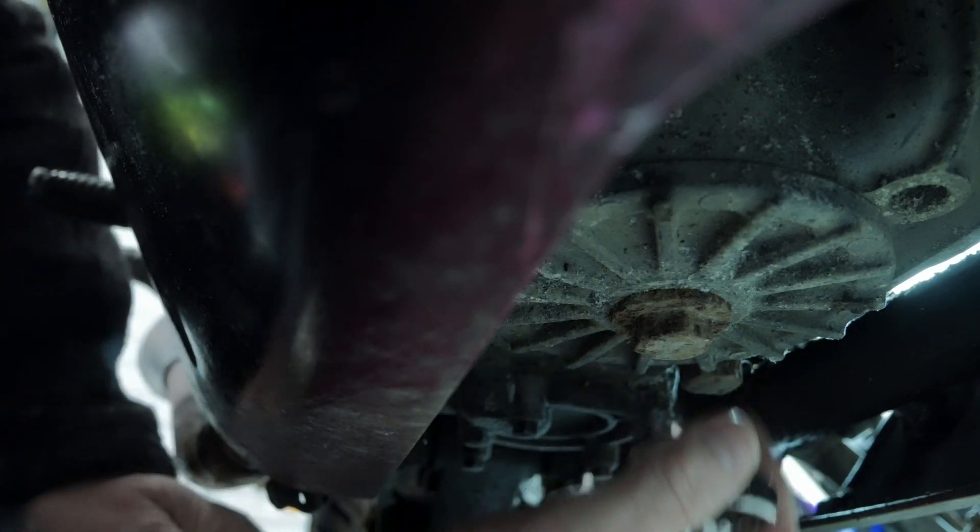We need 1.6 litres, due to the fact that we will not be refilling the actual oil filter. There's our first litre — now we need to get it into the bike. So I have put 1.6 litres of fresh oil in there, so that's in there now and it's all set. Next I'm going to check to make sure the other fluids are topped up as well, and of course don't forget to put the cap back on.